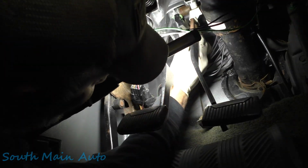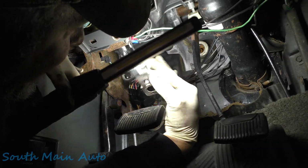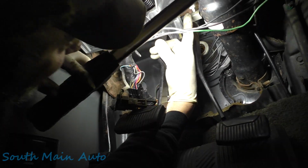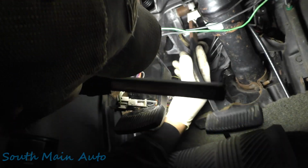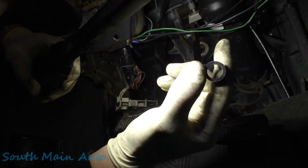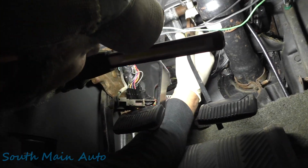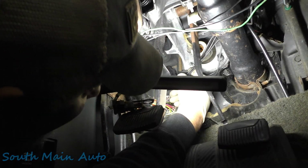Holds that. It should be the brake light switch. And the lever there. We'll take the brake light switch off, we'll set that down here. The other switch up here, that's your cruise cancel switch way at the top. It's got the one vacuum line going to it. It's just a controlled vacuum leak, is all it is, I guess. There's a little bushing that goes in the rod. Stick that down like so. And then 4 bolts, and they look like they're probably 9/16 would be my guess.